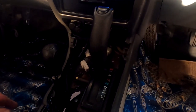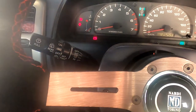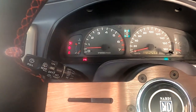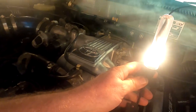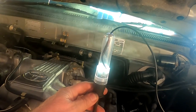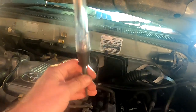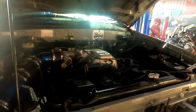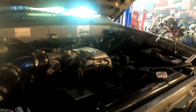I'm just going to start it and try to test load on it. I want to prove that it's not wired right because it didn't start like it should. It should flare properly. Yeah, it turns off with the key. So that should actually stay on for three or four seconds, and that's why it's ugly to start. It turns off with the key, but it should turn off and stay running for a few minutes, correct? A few seconds. Yeah, the ECU should stay on for a few seconds. The engine should turn off, but the ECU should stay on. Correct. Okay. Not bad for a farmer.